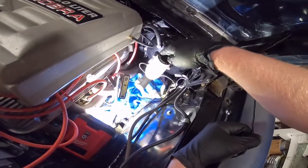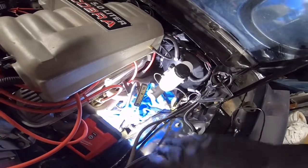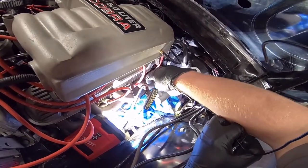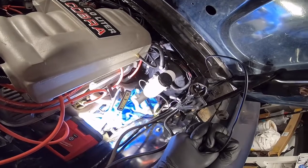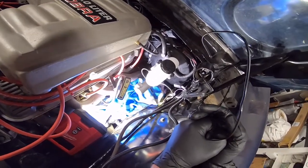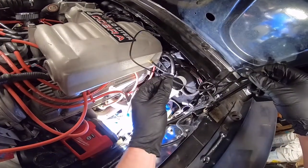This is a master cylinder for a '96 Mustang with a V6 — it had all discs and it bolts right in there. The lines are on the passenger side though, so you're going to have to make new lines. A lot of times there's no way around it, you're going to have to make new lines, and it's really not that big of a deal.